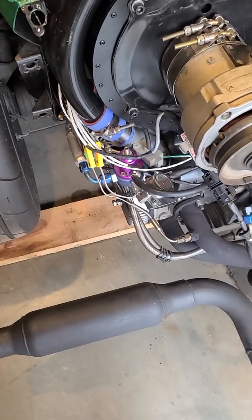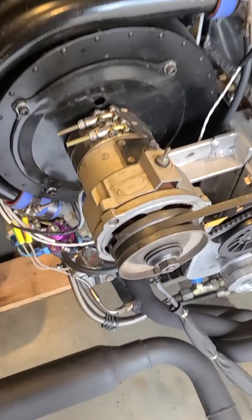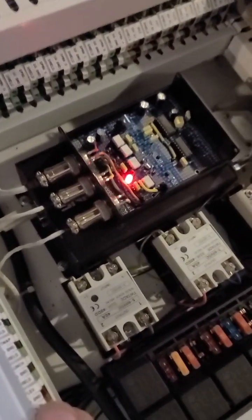I've had this working on a breadboard, but not on a final product — and when I say product, I'm not trying to sell it, I'm just making something for myself. I have this circuit board here that I made. Two of those connections go to the sensors and one goes back to the MS3X cam input on the controller.